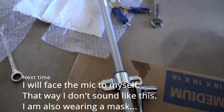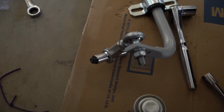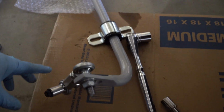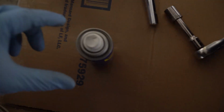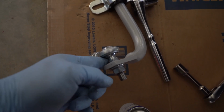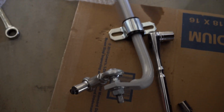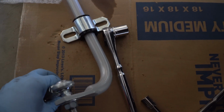Alright, so we are preparing the Whiteline rear sway bars for the Veloster N, and we installed the SPL Endlinks. These SPL Endlinks came used and the rear sway bars are new. When we were installing these, it was a little difficult for the bolts to go in, so we used some WD-40. On the left side is a 17, a little bit smaller than 17. These are also, since they're used, a little bit stripped. And on the right side it's 19 millimeters, and we already torqued them to 35 foot-pounds of torque.